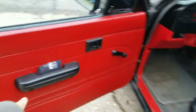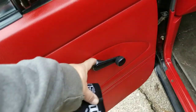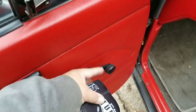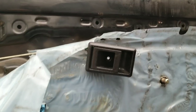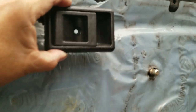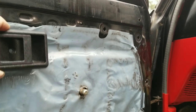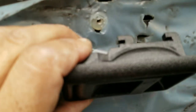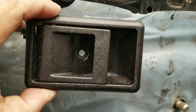For now we're going to get these off. All that is, is there are two screws down in here and then there should be a screw right in here, and then we've got to pop this off. There's a little thing you can pop to get that off. We're going to get this door panel off real quick. When you get that screw off, you're going to pull this — it's going to have to slide out toward the front of the vehicle, because these little hooks right here hold it in. You have to push this forward and then pop it out.